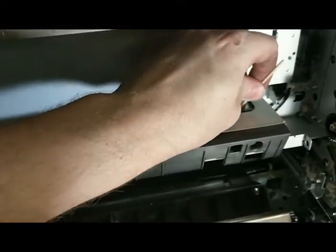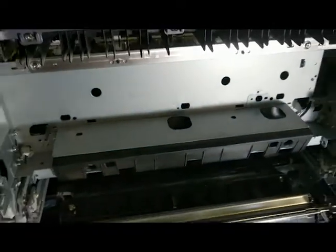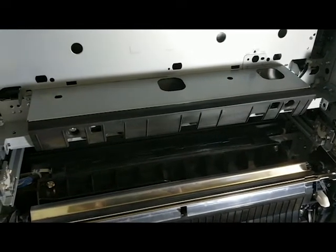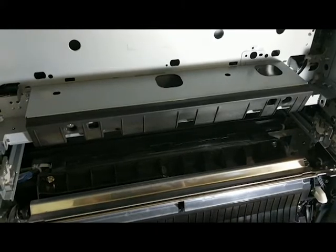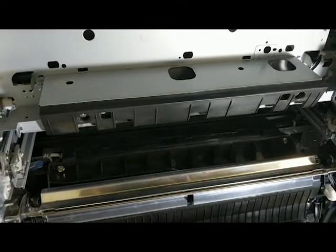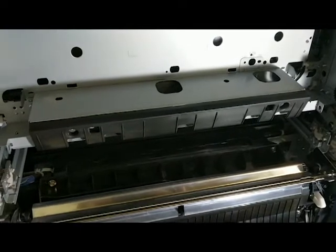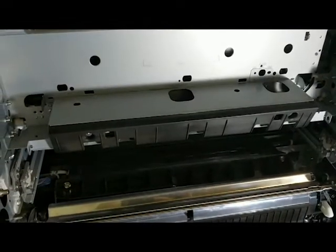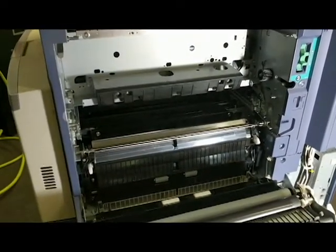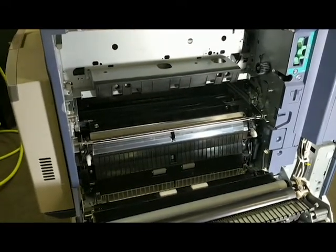These sensors monitor the heat of the fuser. If you ever have an issue where your machine is taking a really long time to heat up, or is pausing mid-job with the panel telling you it's still heating up and to wait, cleaning these sensors is probably a quick and easy solution. So that's five sensors total that you can clean right there on the right-hand side of the machine once you have everything out. Now we're just going to put everything back together and try it again.